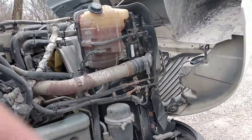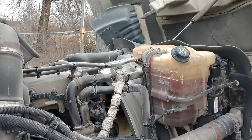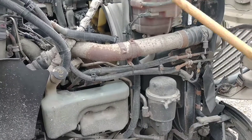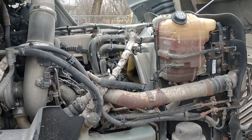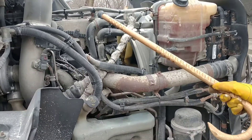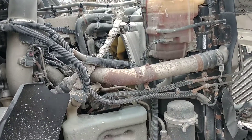I'm going to start with the general observation of hoses. My upper radiator hose, my lower radiator hose, my coolant lines and heater lines — they are properly mounted and secure on both ends, not missing any nuts, bolts, or hose clamps. Rubber parts have no abrasions, bulges, or cuts. Metal parts are not cracked or broken, and there are no leaks.